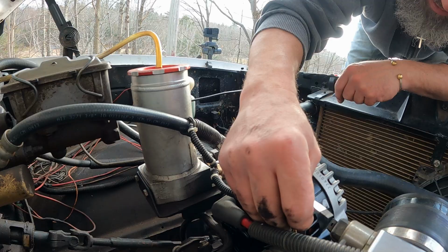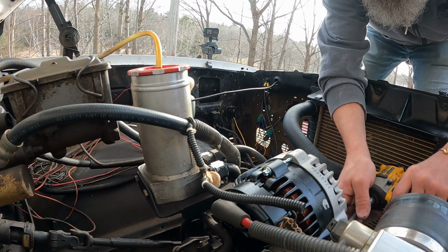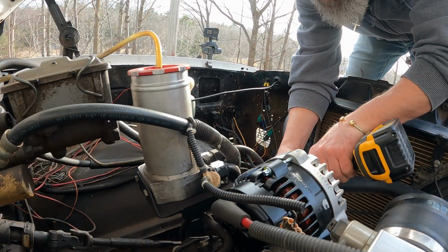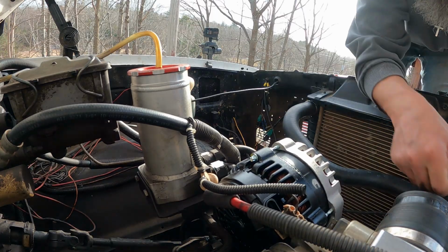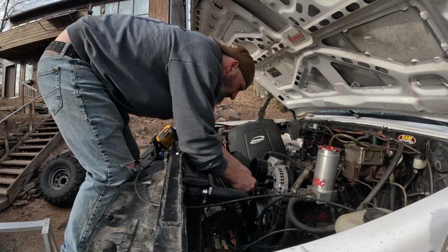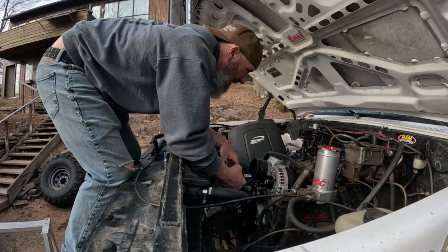Almost fits in there now without that plastic piece on there. So what I'm going to do is loosen that up. Take one bolt out, loosen the other one, swing that alternator up, put the plug in. I think it'll clear after, get it back down past the intake. We'll just plug that in. I think we're good. Yep, it just misses it. I mean by like a hair.